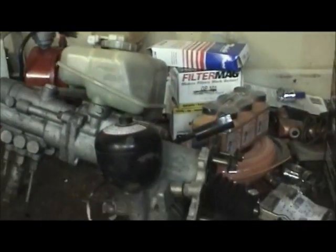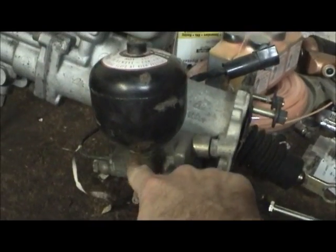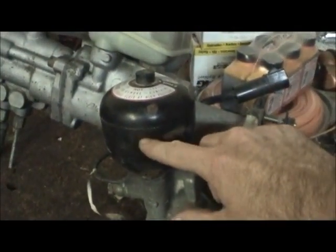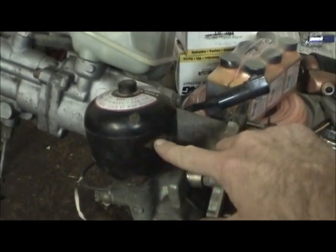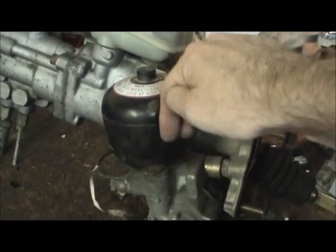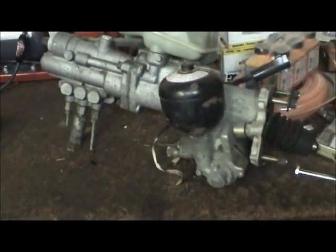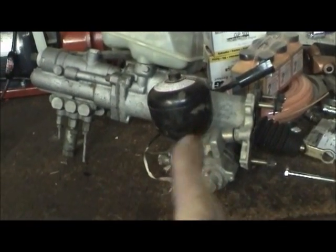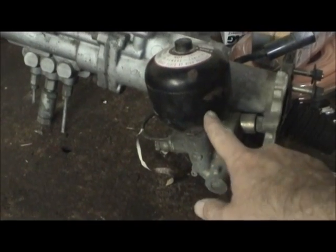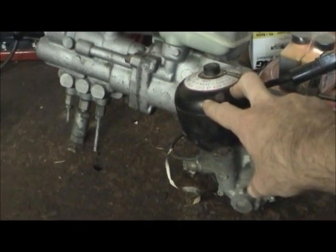What that pump does is it builds up pressure here, pumps fluid into this thing right here, which is called an accumulator. What's inside here is a bladder, and it's charged with high-pressure nitrogen. That pressure forces the fluid back down to provide boost to the braking system, much like you'd have on a regular car with a vacuum booster. Instead of having a vacuum booster, it's all done electrically with the high-pressure pump. This charges to about 3,000 psi to provide the correct boost.